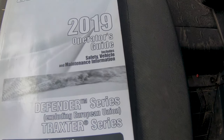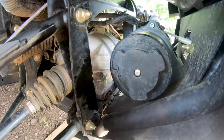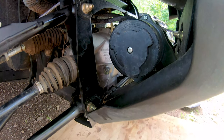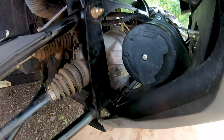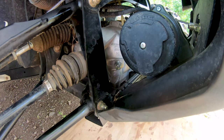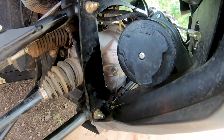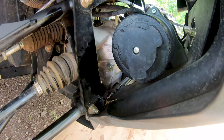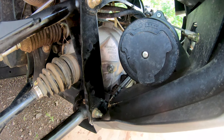Sorry about that, but that's all we can do. Lesson learned the hard way, folks. I put some oil in there — they recommended I put some in so I could get it on the trailer and bring it into the shop. I was able to get the bolt out again and take a look. The bolt itself is fine; it's the aluminum differential that's stripped out — the threads are stripped out. What they can do is tap it to a different size bolt or tap it again to the same size. That's totally a mistake in the owner's manual for specifying 24 foot-pounds. I would only hand-tighten that tiny little nut if you're going to change it. They're two weeks out so it's going to be a while, but thanks for watching.